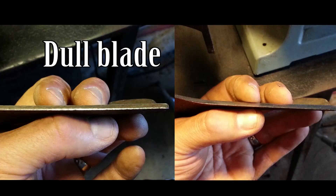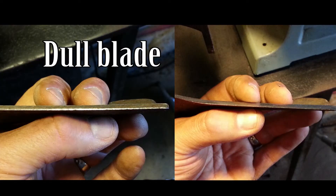Here is a dull lawnmower blade and one that is sharp. With a light behind my shoulder shining at the blade edge, you can clearly see a well-defined silver line shining back at me. A lawnmower blade, or any blade for that matter, is considered to be sharp if there is no light reflected back from the leading edge. Any shine at all means the blade is dull.